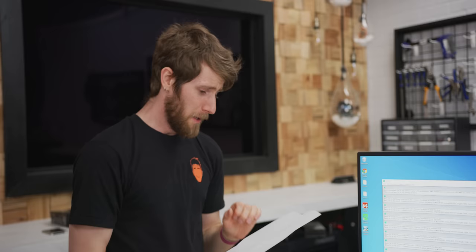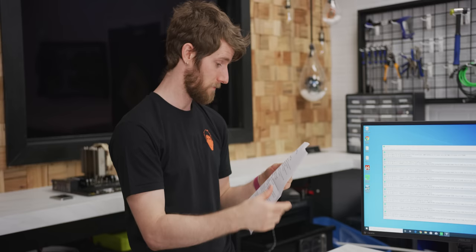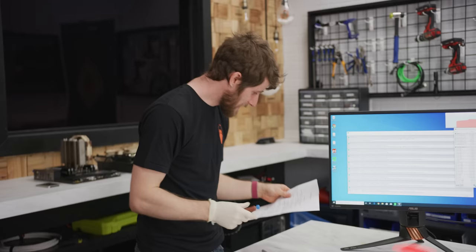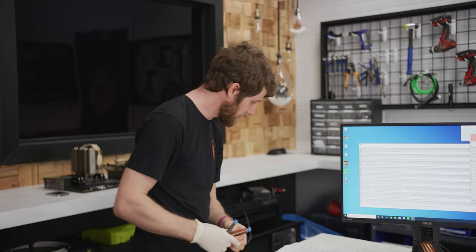Before using the Tech Ingredients product, I reviewed the instructions: wear gloves, protect your work surface with disposable plastic film. Contact with epoxy can irritate the skin. After preparing and cleaning the surfaces, remove the caps on the syringes and eject the quantity you plan to use. The mixing ratio is three parts large orange syringe and one part small black syringe. Watch out — the orange syringe is more viscous, so I needed to be a little careful to get the right quantities.